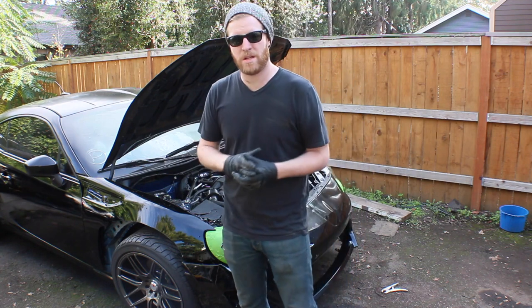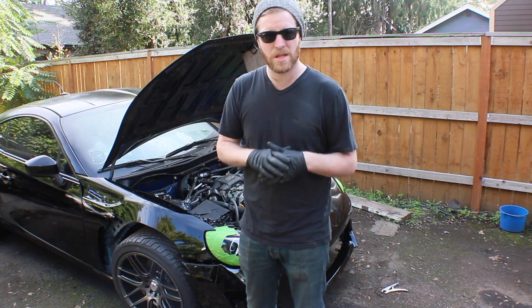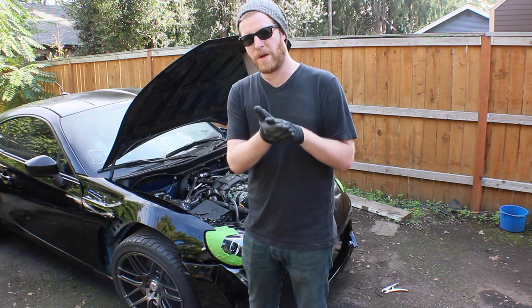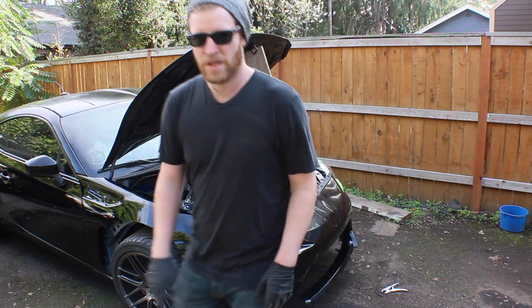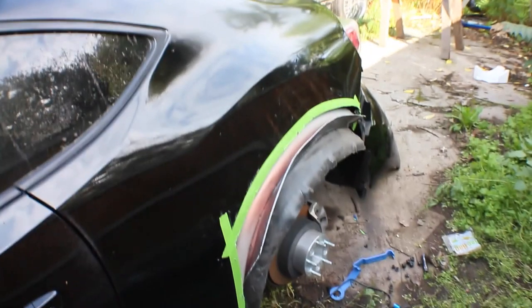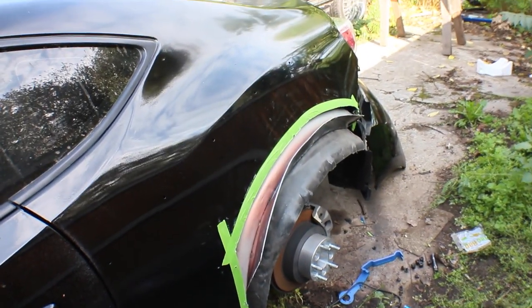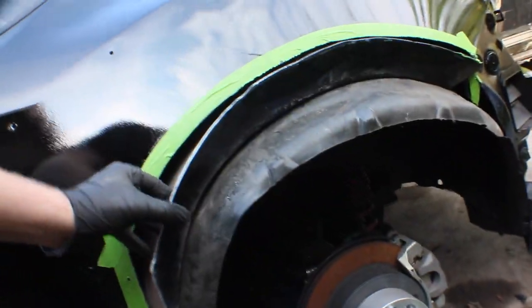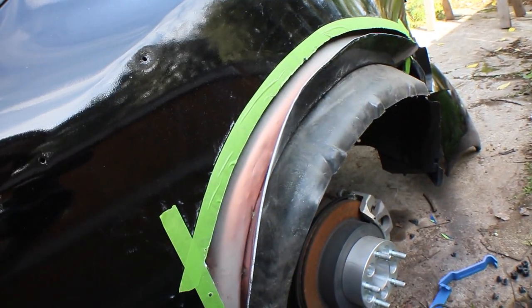So one thing I wanted to show you guys — in a previous episode we cut the rear fender, and we said okay, cut through the two skins. But I actually just learned — and when I say two skins, I mean the outer metal and the inner metal for the fender — I just learned something pretty cool, so I wanted to show you guys this. Here we are on the passenger side fender, and these need to be cut out a couple inches above to give the wheel room to travel outside the frame. In the previous one we cut through this — this is the outer skin — and we cut through this with one kind of big stroke of the body saw.